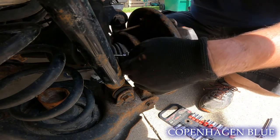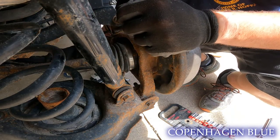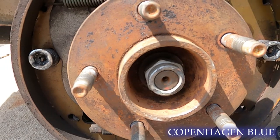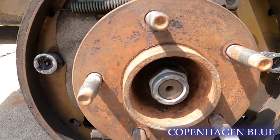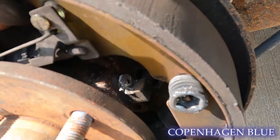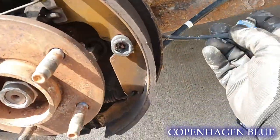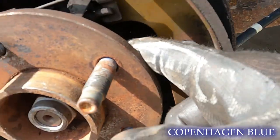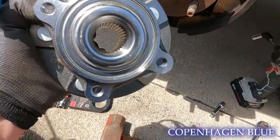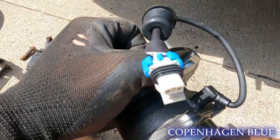Let's see if we can get our bolts out. Now what we have to do is try and get this axle shaft to tap out, because it's got to have some movement — otherwise it can be seized to the splines at the inside of the hub. We also need to look at the wheel speed sensor, which is right down in here and connects up here. So we're gently going to undo that and pull it back through. Once we get that out we should be able to undo the wheel speed sensor. You can see the four bolt holes and the spline we need to make sure is loosened up.